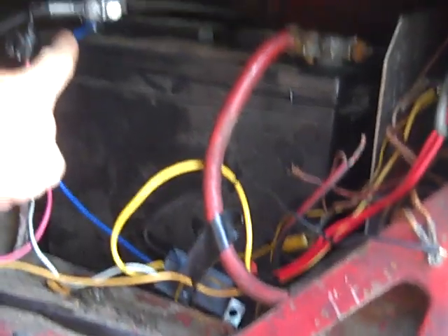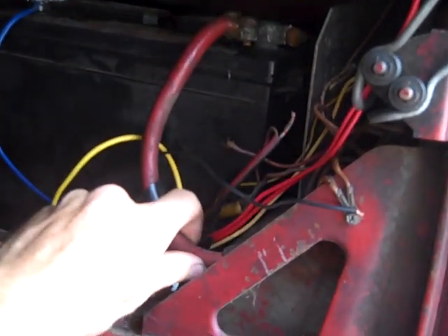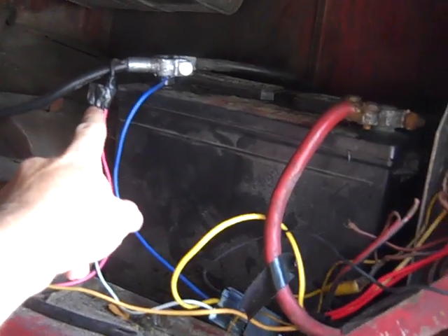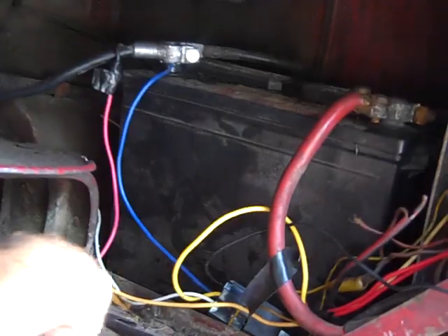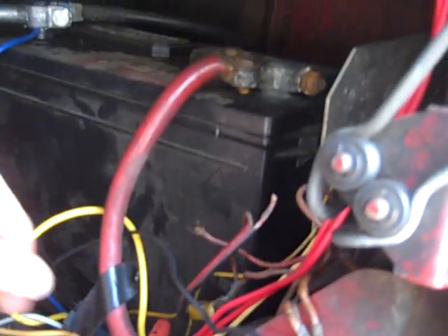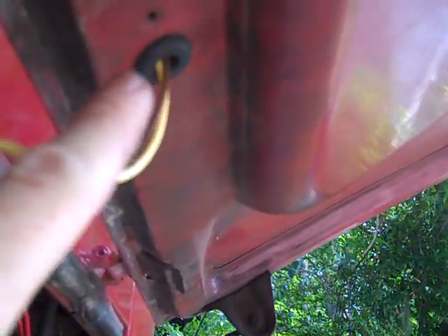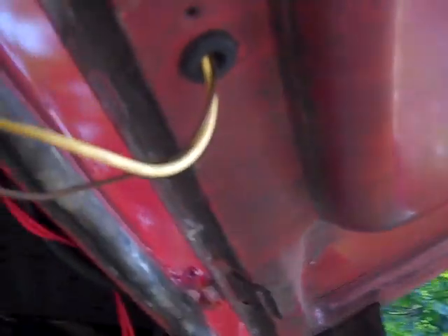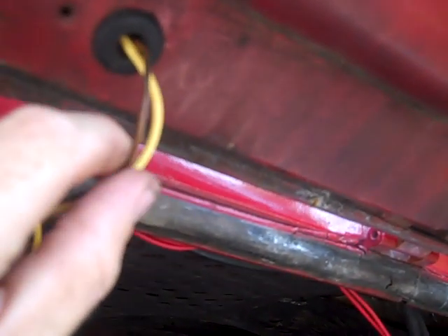I ran one wire to the positive terminal. This is not my negative terminal — that's my positive terminal — but I guess they bought one that was short and the black one must have been long, so they switched them. That could have caused a big headache if I didn't know to start with, but obviously there's a red wire coming out of there that goes to the alternator and the starter, which kind of gave it away. I took my relay wires and put them up over here and strapped them in. Another problem I had was in the harness — a wire was busted, so I didn't have my lights to be legal. I ran another yellow wire; it would be best to find a matching color, spray paint it, or label it with masking tape.